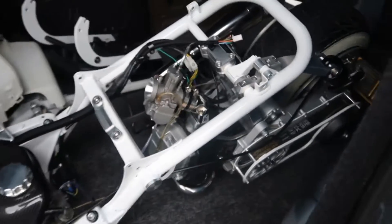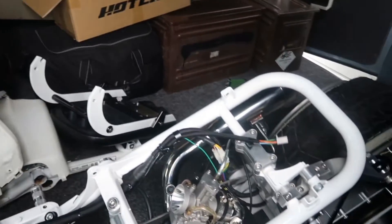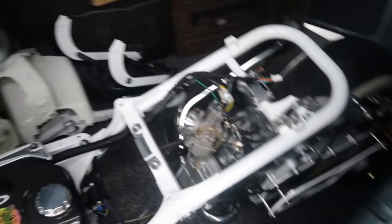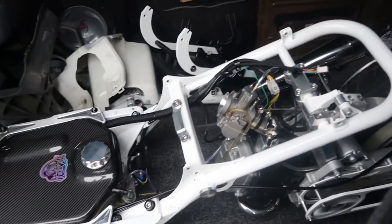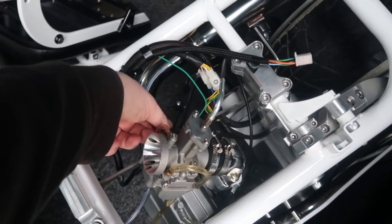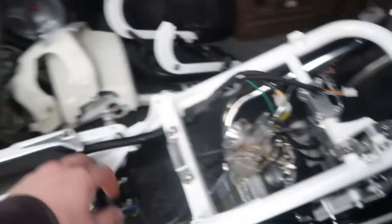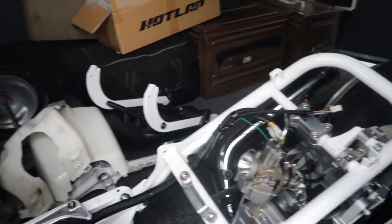It's been drying for about an hour or so. It's going to be a bit tricky doing this one-handed, so bear with me. There you go — that's what we wanted! Now we can tweak the idle, bring that up a little bit, and tweak all your mixtures. Ideally what you want to do is stick an AFR gauge in the bung and actually get your readings nice throughout your whole rev range.